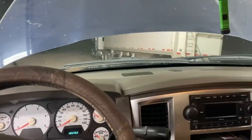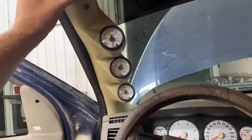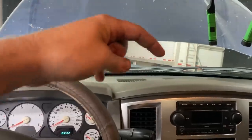I just got a new EGT probe because the other one that I had broke when we took the fitting out of the manifold. So I got the screw here and I'm just loosening it now. Gonna take these down, route the wires down, pull my new one through, and stick the probe into the manifold. Now I'll go take her for a test drive, make sure she works.